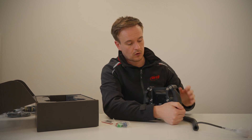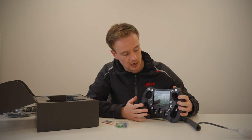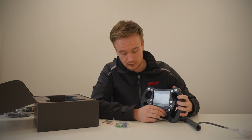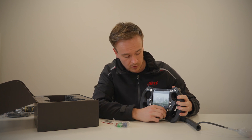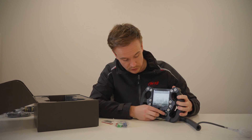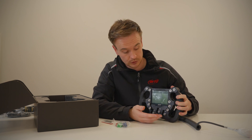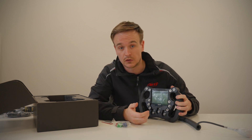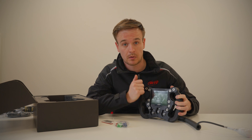With this wheel you can assign these buttons to whatever you want. The clever part is that depending on where the rotary switch is selected, each individual button can do something different depending on the rotary position. For example, in position one a button could be used for a flash, and in position two it could be used for wipers. The whole thing works on Canbus so it is completely configurable.